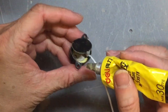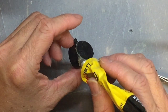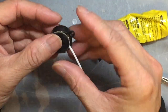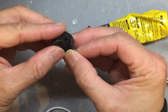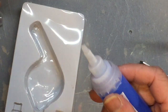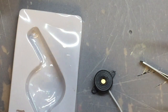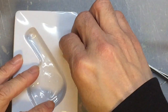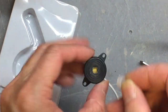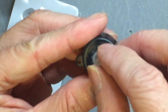Apply the soft glue to seal the cover. Don't use the instant drying glue because it's too strong — when the cable gets loose and you need to reopen the cover, using too strong a glue means you'll regret it and damage the box. Next, use the strong instant drying glue: put some on a flat surface, then roll your hearing aid tube onto it so enough glue is applied. Make sure you align it with the hole in the center.